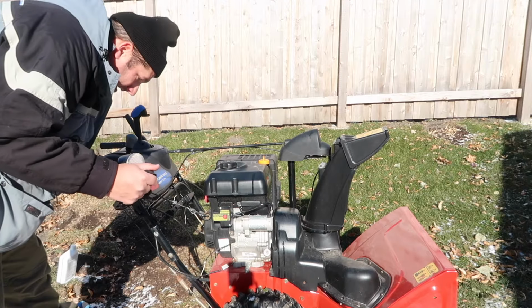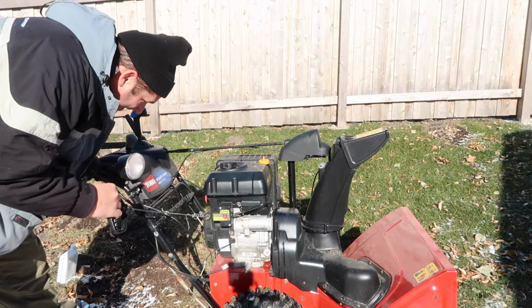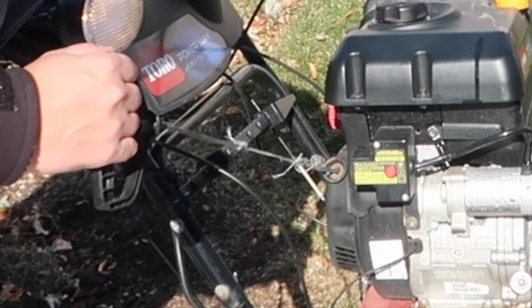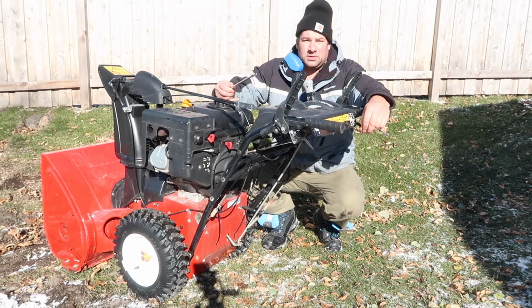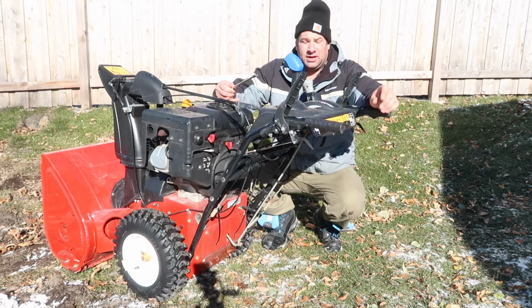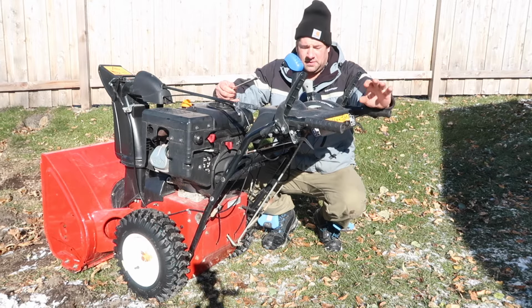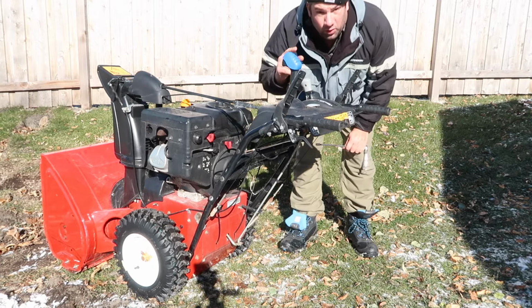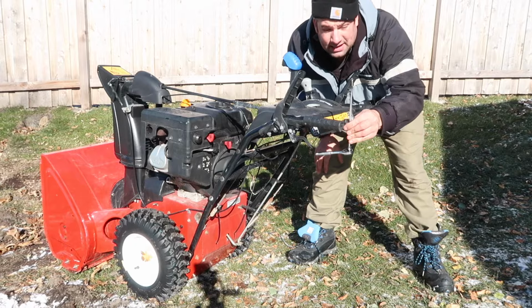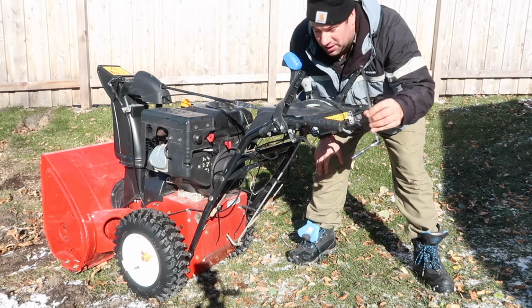And just like that, I have a frayed, practically broken pull cord. I'm going to show you how to replace it. It's super easy. I just got this out of the shed and did the oil change and spark plug. You can check out the link in the description for that video. And of course, my pull cord is shredded. I believe it's 4 bolts. I'm going to use a 1/4 inch ratchet with an extension and an 8mm socket on it.